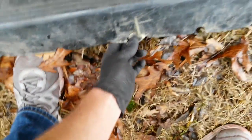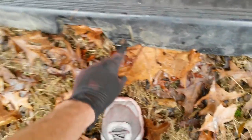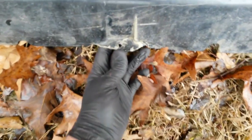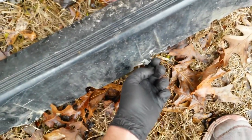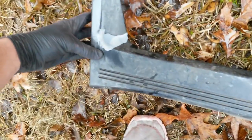A couple of these holes — these two are intact mounting holes here. On the other piece, there are actually four, and all four are good on that one piece. But on this side, the front one and rear are okay, this one's torn and partially missing, and this one's torn away. I'll probably just rebond that. I'll have to copy this and add some adhesive here to remake that part where you can mount it. There's also a little bit of a twist to this — it needs to be turned some. I'll have to heat that up; that's where it flexed.